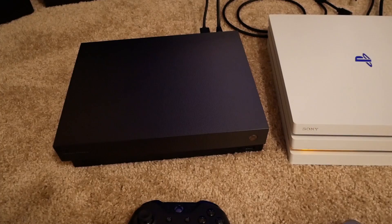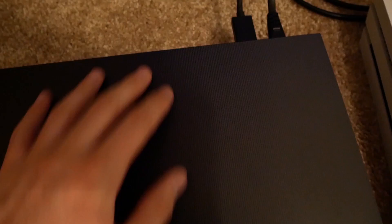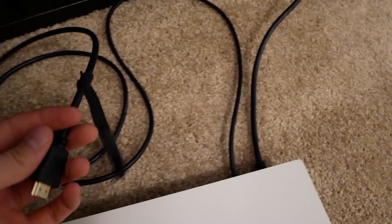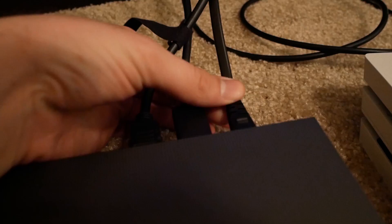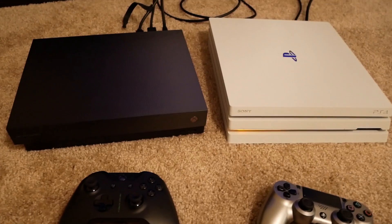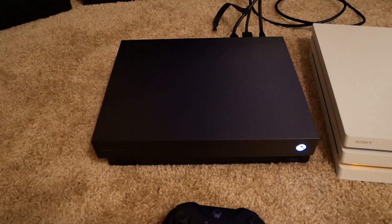Let's get into the steps. Both consoles have power plugged in. Your Xbox has its HDMI cable plugged in and the other end going to your TV. Now here's where it gets a little different: you take one end of another HDMI cable and plug it into your PS4, then take the other end and plug it into the second HDMI port on your Xbox One. So going from the right on the Xbox One, you have a power plug, an HDMI to your TV, and the next HDMI port goes to your PS4 — kind of like a little loop.